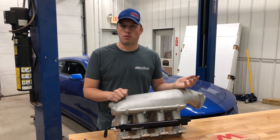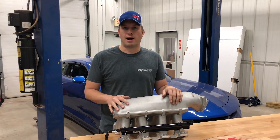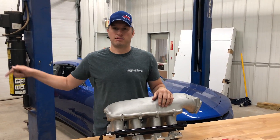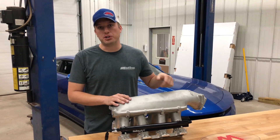The only thing you'll want to make sure of is that you put a check valve in line with that pump. That way, when the belt-driven or mechanical pump starts taking over as the engine fires up, it doesn't feed back pressure through that smaller pump.